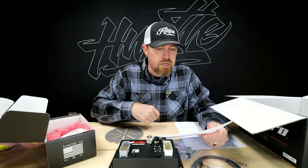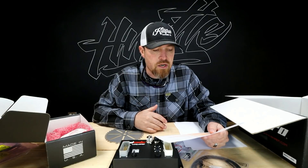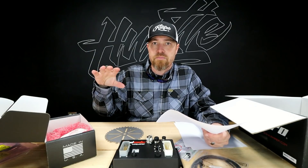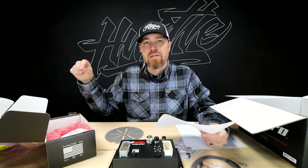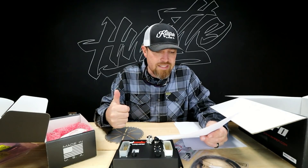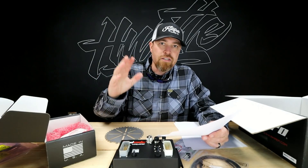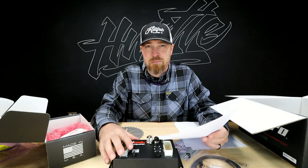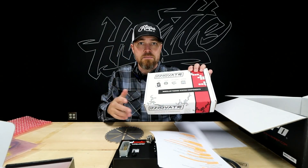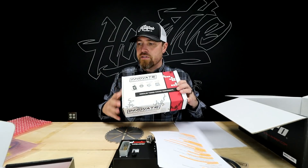These systems support 50-plus specialty OEM and aftermarket ignition systems using factory cam and crank wheels and sensors, so you can adapt many existing setups. It has an internal SD card for high-speed data logging, traction control, E85 flex sensor support, and it's compatible with any wideband O2 setup. If you have an Innovate Motorsports unit or really any wideband, you can tie in the analog outputs and this unit will read it.